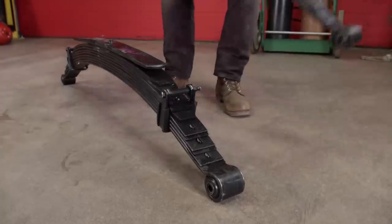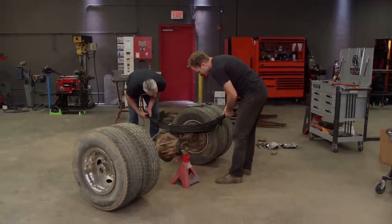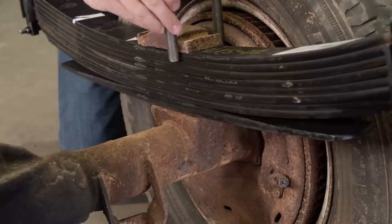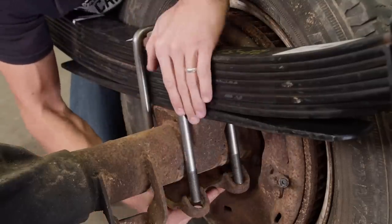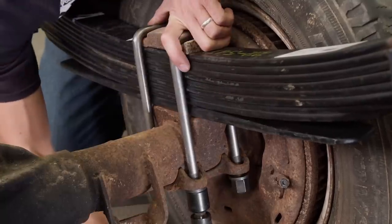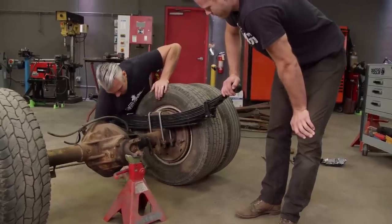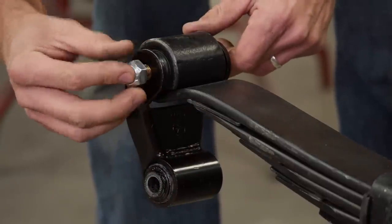The new springs we're installing on the tow truck are definitely heavy duty enough to tow a vehicle. These are nine-pack leaf springs with a 3,500-pound rating for each spring pack. We're installing these reusing the stock U-bolt plates, but replacing the U-bolts and nuts and just snugging them up for now. We'll torque these to spec when everything is sitting under the chassis. We'll also loosely install the shackle, which will help us install the axle later.